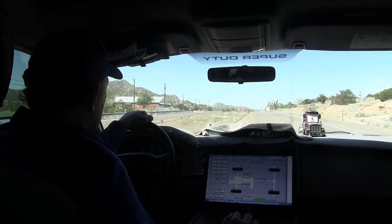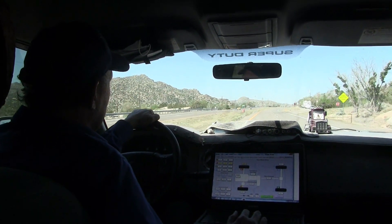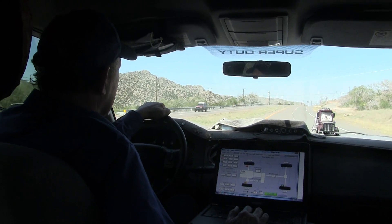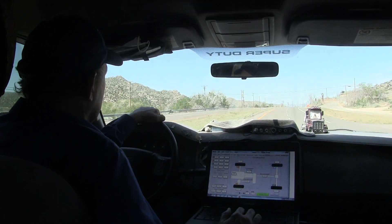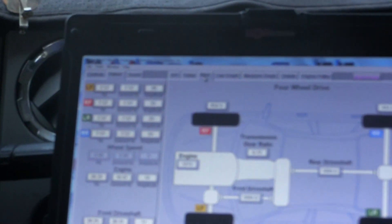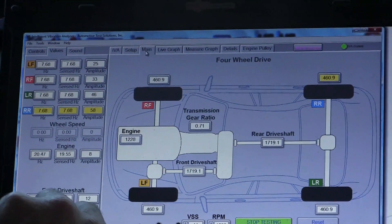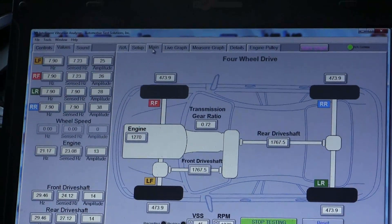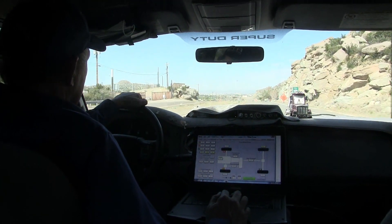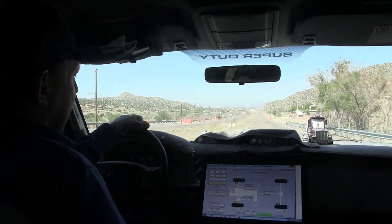We've got the IVA connected and we're on a test drive right now, doing about 45, and I can feel the car shaking. It's got some type of a hop — it almost feels like a suspension bounce with one of these big trucks when you're hitting bumps, but we're on a smooth road. Our numbers are very low. If any of the tires or shafts were having any type of rotation, we would see the vibration in the 80s to 100s. The vibration is definitely not in any of the tires.